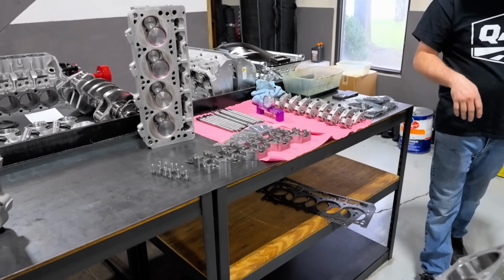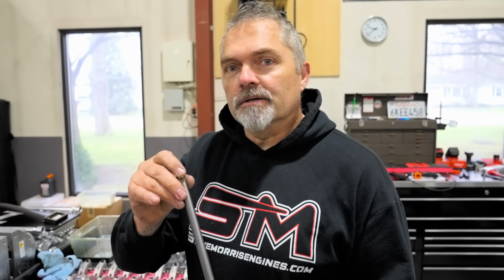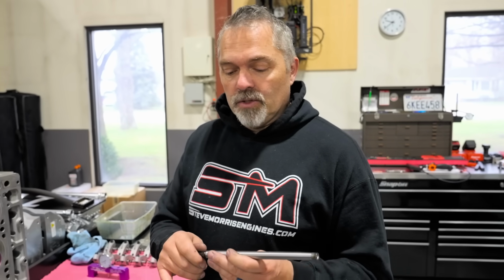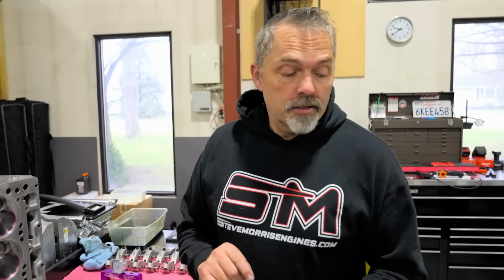And it's an interesting thing too, that these are actually a bigger diameter push rod than I put in the SMX, which is pretty interesting. And that all goes to prove that whole point of what we just talked about earlier, on the valve train dynamics and how stuff runs, and weight isn't important over here. Why do I not have a bigger push rod in the SMX? There's actually a little interference issue inside the intake port and the valve train. Not needed, obviously. And could I use these or build something to make these work? Probably, but I really don't feel like reinventing the wheel, because there's some water jacket issues and things in there that I can't make everything fit in the world. So that's why I use a 1/2 inch push rod on the SMXs.